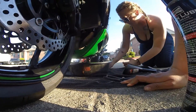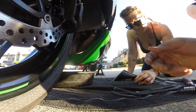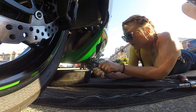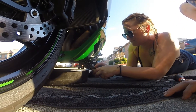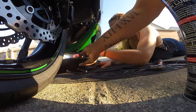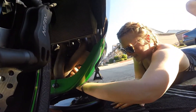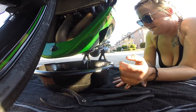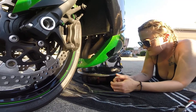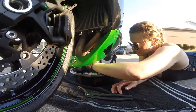It's going to come out pretty fast — just let it drop. Now we're draining oil. While that oil's draining, go ahead and take your filter pliers and grab it right here. Squeeze and pull towards you — just keep doing small movements like that. Now you can grab it with your hand and twist it off. Watch the oil — bust it loose and let it drain from there. As you guys can see, they're both draining right now.